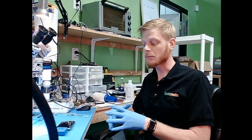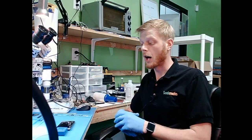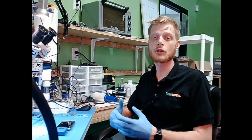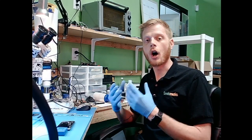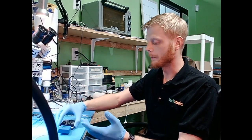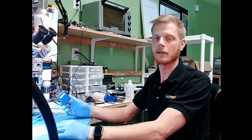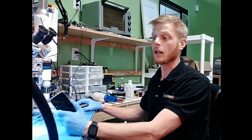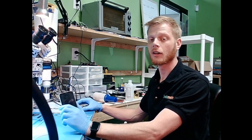I like this test because it's something I can give my coworker, something I can do up front to show — look, your TriStar is bad, or hey, maybe it's your charging port, maybe it's your battery. But this test isn't 100% accurate. Now it says here battery is missing but still passes the test. I've seen that say that and the battery be brand new or just fine. So again, not 100% accurate with everything, but it's accurate for the lines that it's testing.